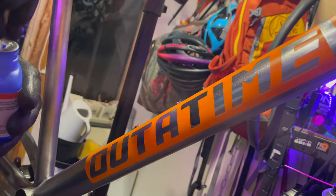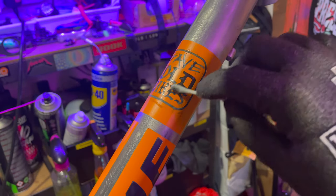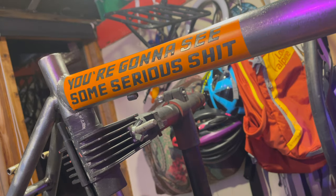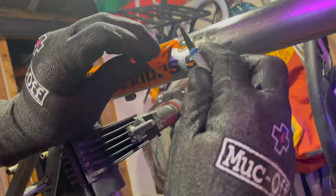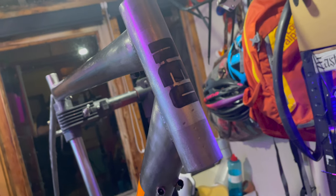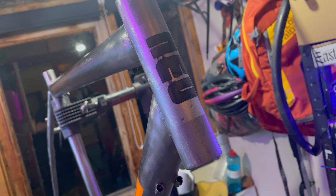After testing, I just went to town on it. Big lesson: less is more. A couple of times it started dripping past the vinyl and I had to quickly wipe it up — it did leave a couple of marks and it's a pain to fix. Take your time, do smaller coats and it'll be much easier. To fix the bleed, I used a bit of sandpaper to sand between the edges and letters — it doesn't remove it completely but enough that it's not obvious unless you're looking for it.